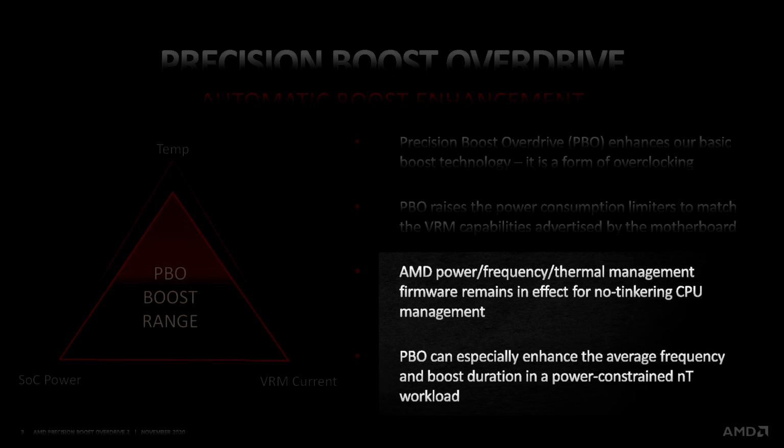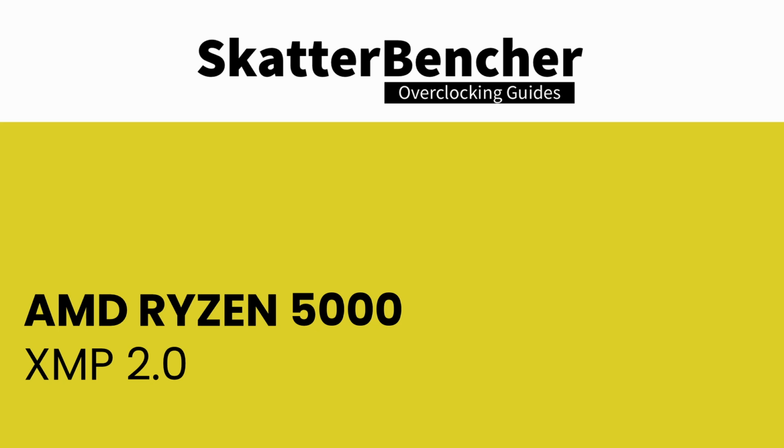Note that while the power and current limits increase, the CPU operating frequency and voltage is still governed by AMD's Precision Boost algorithm. Extreme Memory Profile, or XMP, is actually an Intel technology that allows you to automatically overclock the system memory to get better performance. It's an extension of the JEDEC standard and allows memory vendors to program different settings onto the memory sticks. Those settings include the frequencies, the memory timings, as well as the memory voltage.